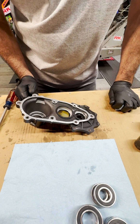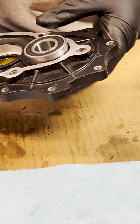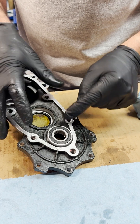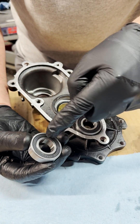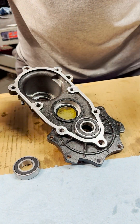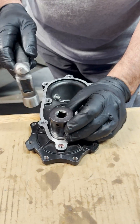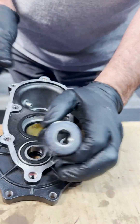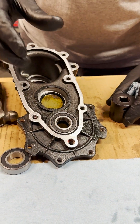For the bearings, we have the two smaller bearings — they're going to go up here and we'll push them in, hopefully by hand. Always remember: you're going to be pushing on the outside race if it presses into the case. So you're pressing from the outer race, like using a socket. Do not push on the inside race — that'll put tension on the bearing and destroy it. Always tap on the outside of the race, either with a hammer or a socket. It shouldn't take too much force. If it's cocked, it'll take a lot — try not to cock it, just walk it down.